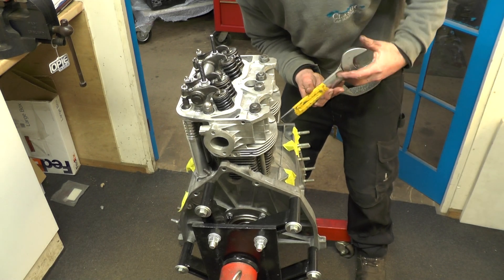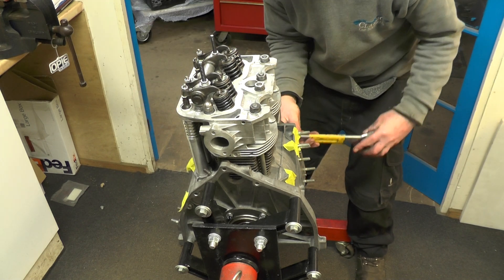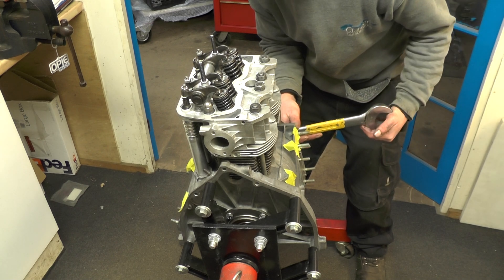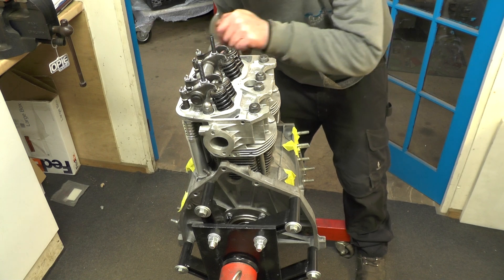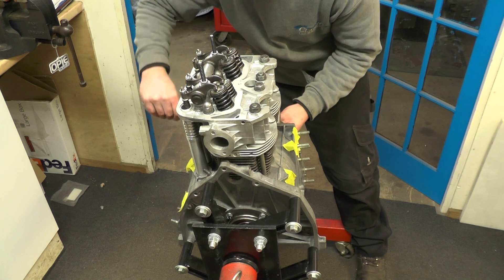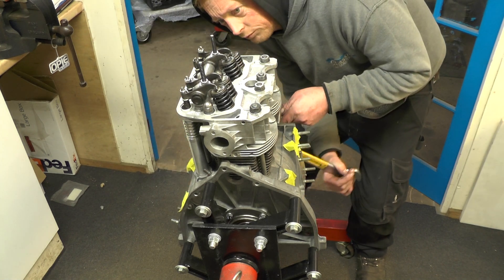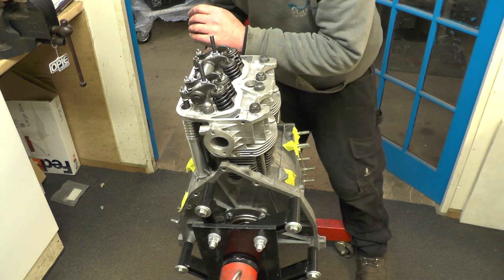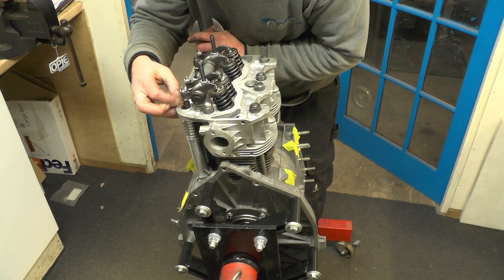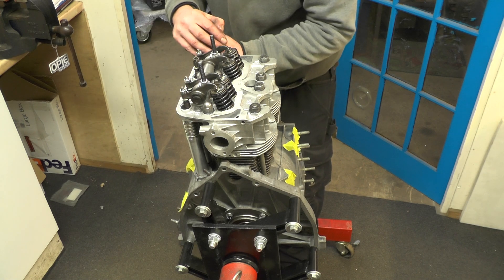So you can go right through and we've got lots of clearance there — correct, that one's opening. And then this one's going to come up now, so at maximum lift we have clearance under here. Good. We've got one more to check and we're not hearing those valves hitting. Another thing is checking push rod tube clearance — seems a little bit tight, but not really much you can do about that.